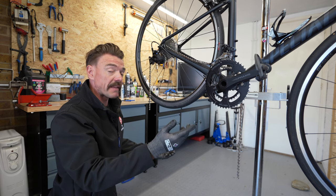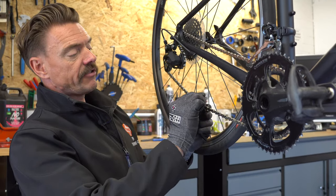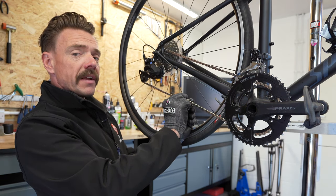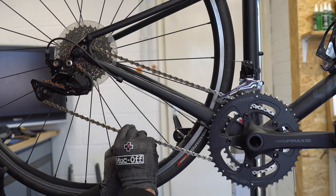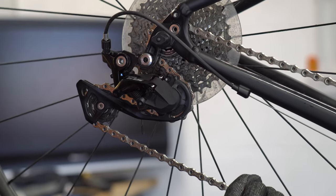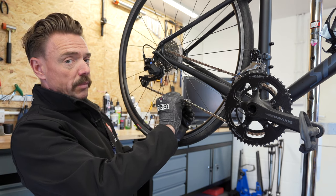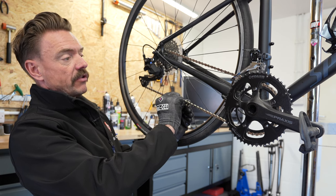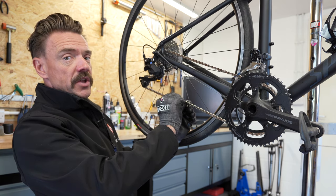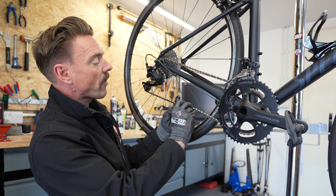I put the bike in small-small. I put some tension into the chain and simulate the chain being joined up. What I want is that even in the slackest drivetrain combination that exists, I still want there to be some tension. Look at the lower arm of my derailleur — that's with no tension, that's with the derailleur hard against it. A little bit of tension. The idea is that even if you shift into small-small, which you're not really supposed to do, your chain will still be under tension. You're aiming to have it so there is no combination of gear anywhere where you can artificially introduce a slack chain into the system.